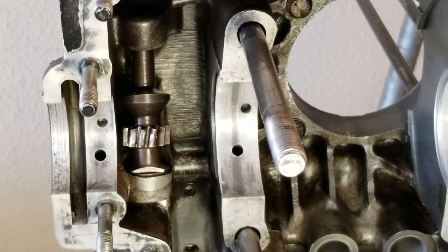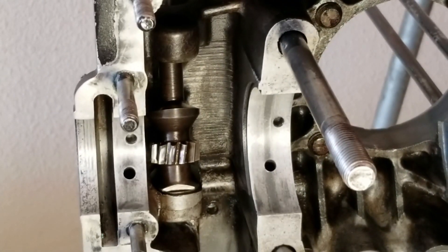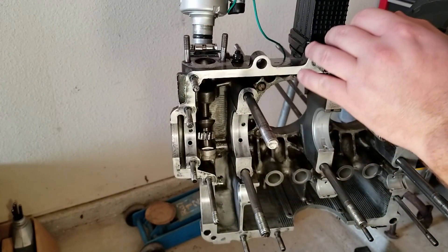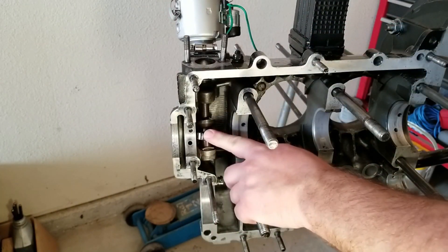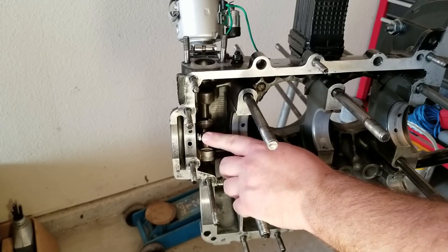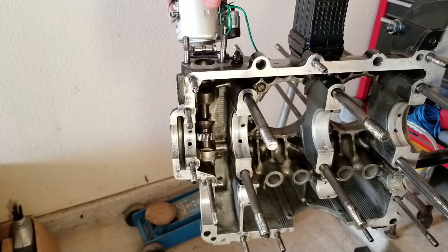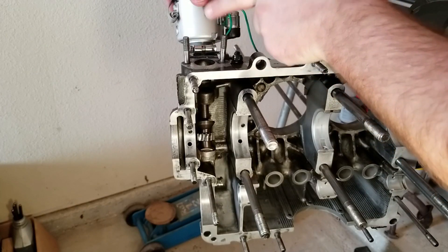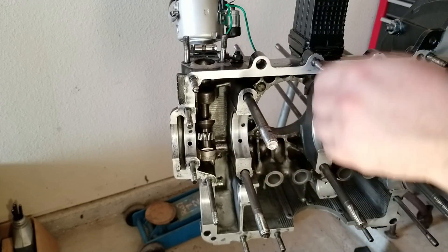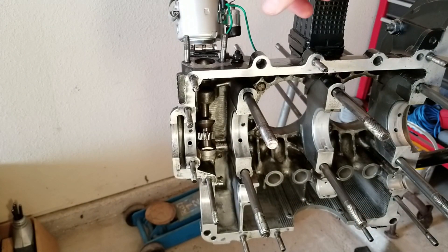What I recommend is that once you've got your drive gear down in and it's straight across, you take your distributor and install it right down where it's supposed to be. Straight across on the flat, and then your actual rotor will be pointing towards the timing mark in your case. You want to go ahead and push it down and lock down your distributor so that your timing mark is lined up with the mark right here. That'll also give you an additional reference point to look at once you drop your crank in. So let's go ahead and lock it down and show you guys that.